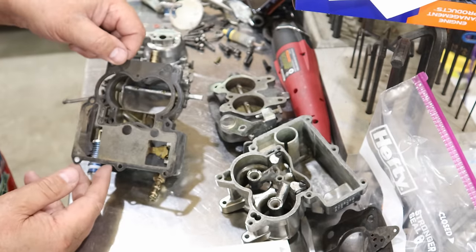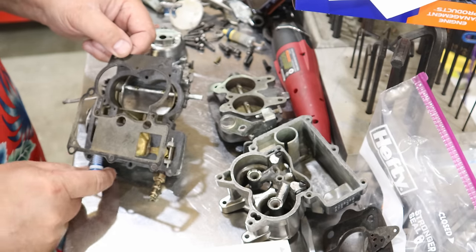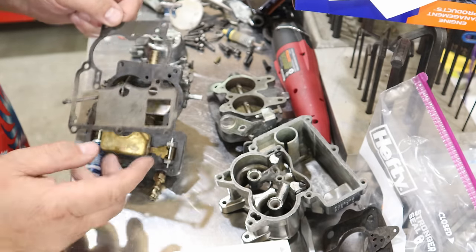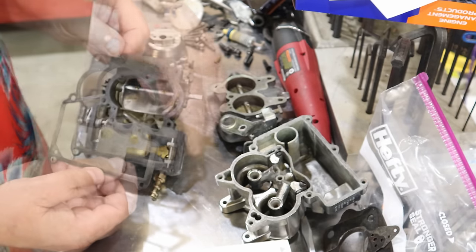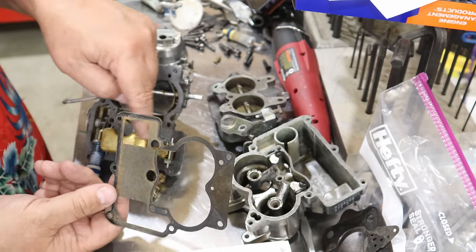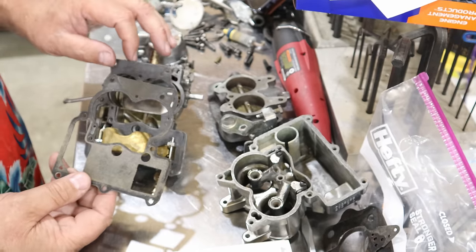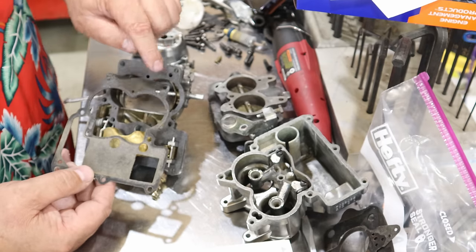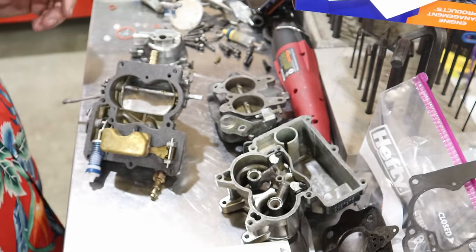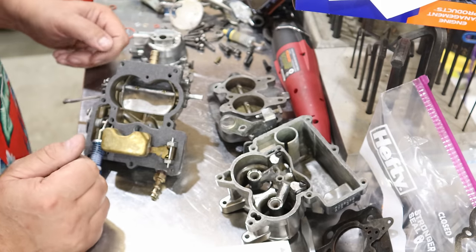Now looking at the other old gasket, that's how it sat in there. You can see where everything fit through. As you can see, that square being different shaped isn't going to hurt anything. There's a hole here, but it wasn't doing anything. It was just over this whole opening underneath it. So we should be okay there. It's not sealing off around it. I was looking at this hole up here. It was just a hole in this one as well. It has a slot underneath it and nothing on this side. So we should be good there. That's why I like to hang on to the old gaskets. If you can get them off without destroying them, it's actually pretty cool.